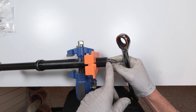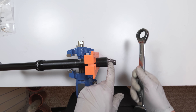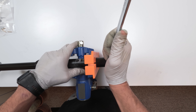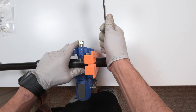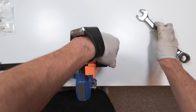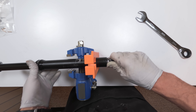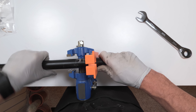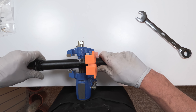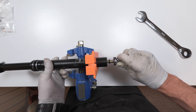There's a bit of an edge — a real small area. In my opinion this whole actuator is old and they need to revise it. There's a real small area on each side where you need to put the wrench in and then crack it open. Then we take this out. I never tighten these guys down hard — I usually tighten the collars by hand. So let's take this guy out.